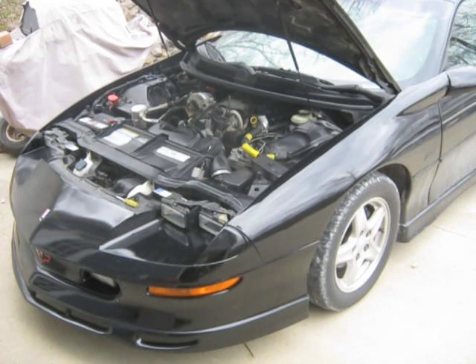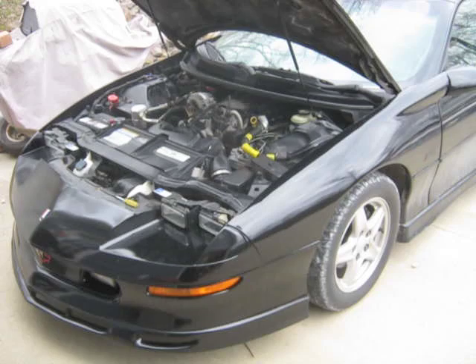This is my 1997 Chevrolet Camaro RS. It's got a 3.8 liter V6 motor and I'm still having some trouble with a hard start — it just wants to crank and crank. In a previous video I replaced the fuel pressure regulator and I'm still experiencing some problems. So I'm going to put a fuel pressure tester on this thing and see what my fuel pressure is.